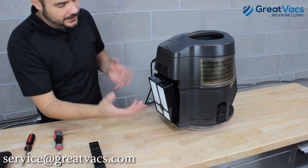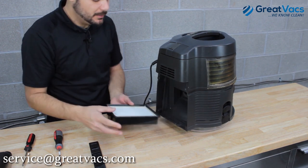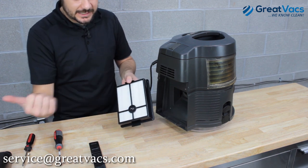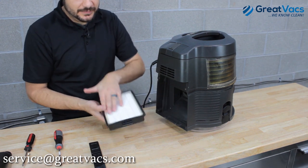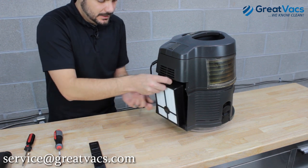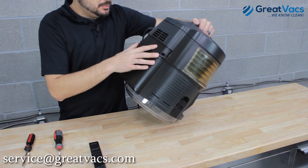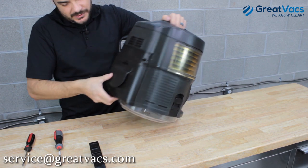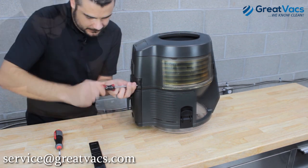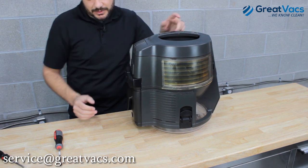The filter goes in place just like the newer model. There's a little tab that sticks out on the bottom — align that tab with the slot on the bottom of the unit. Take your new filter with the grill side facing out: the grill side faces outward and the plain filter side goes toward the inside of the vacuum. Align the tab, and the filter goes right into place. Put the back plate back on, everything lines up nice and smooth, then replace the four screws. Once the screws are in, pop the cord wrap piece back on and you're good to go.